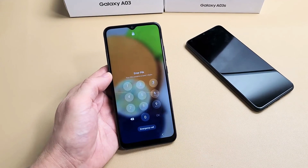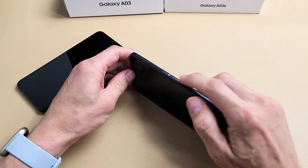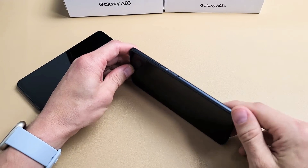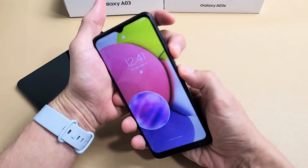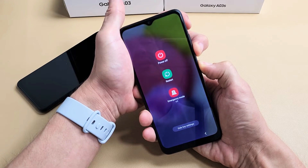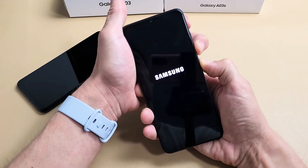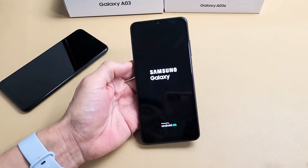However, if you're still stuck in a boot loop, no problem. For step number two, press the power button in and out about three times kind of hard — basically spamming it. Then do Volume Down and Power again: press and hold both buttons. Do not let go until you see the Samsung logo appear. Once the Samsung logo appears, go ahead and let go and let it boot back up, and hopefully you'll go into your login screen.